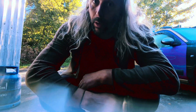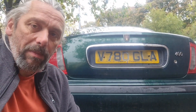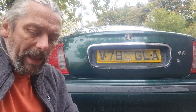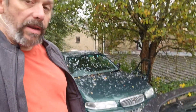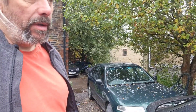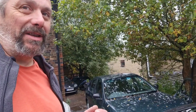Hello. Let's start. Behind me here we have a lovely Rover 400 called Gladys, which was supposed to be going up on eBay, but due to some confusion on somebody else's behalf it hasn't happened. And now, of course, there is a fix I need to do on this car regarding the rear demister — it's staying on, consuming all of the power that the battery has to offer, and then not starting, and setting the alarm off because there's no power in it.